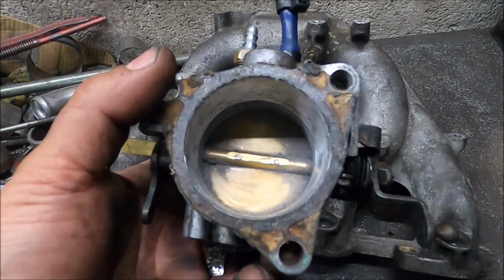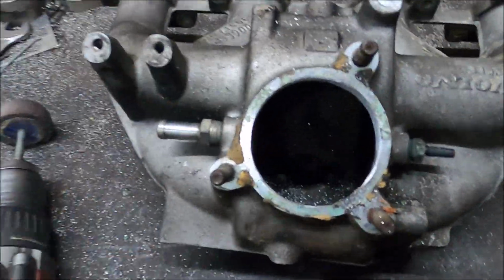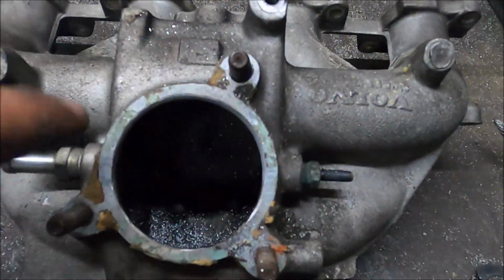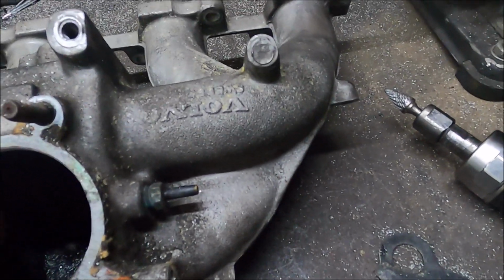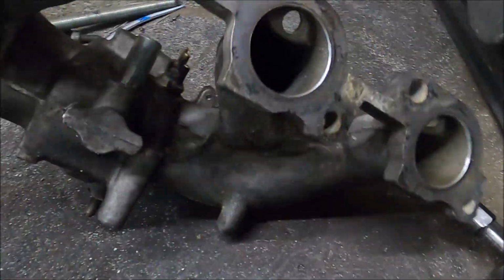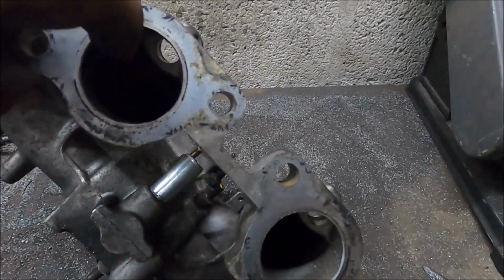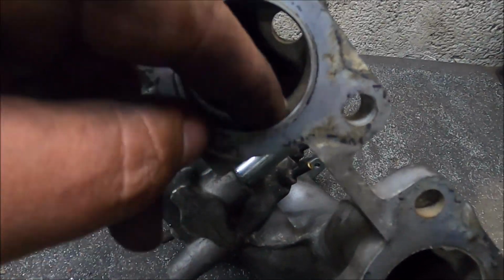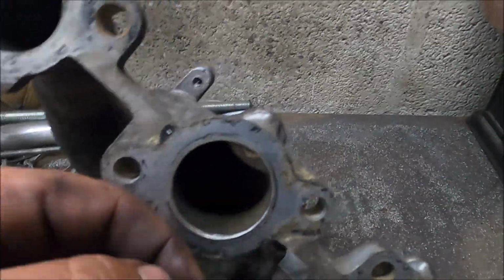On this side is ported up to the gasket face. On here it's enlarged to match that, so no matter what sort of wiggle you put on the throttle body, there's never any overlap. On the inside, it's as smooth as you've got to get it, really. And on here, the only real problem I could see was the casting made rough, sort of scabby edges, and I've got rid of that. Even the seam from the mould doesn't stick out, not enough to be worth grinding it off.